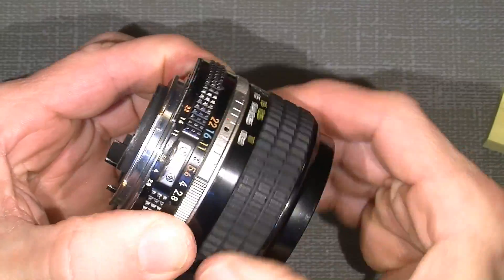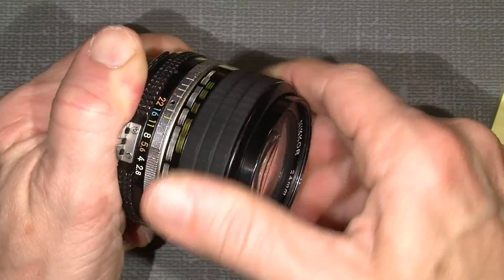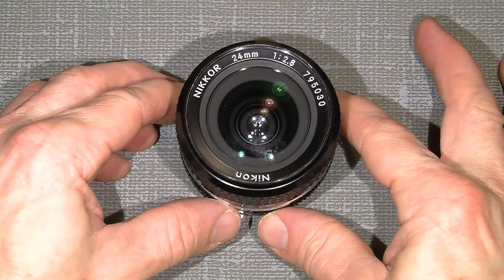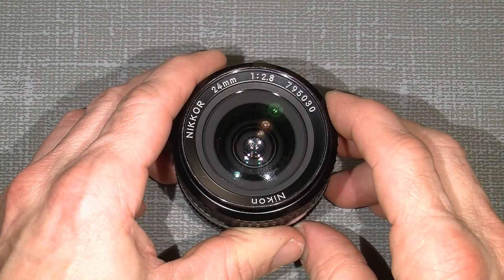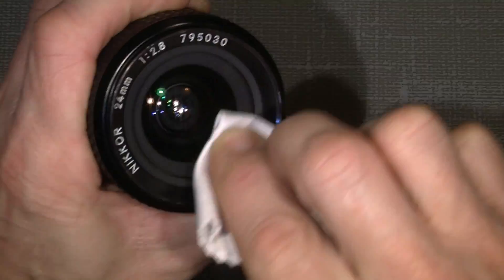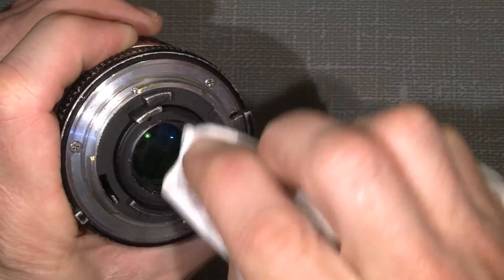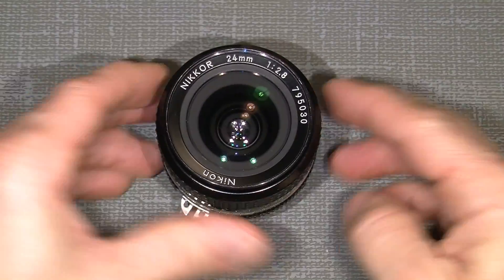So put the focus ring on infinity - because this one also has to be on infinity. And maybe you remember I set a mark where infinity actually is. Then I have my guide pin here that goes into here, so all is going all the way, and hopefully it will catch the pin here. Goes there, and the guide pin is in. Then I just need to add my front ring. Now tighten the small screw here, not too much. Add the retaining ring - click - on it goes and then tighten. Then the rubber band here - put it on so it sits correct. So this old fellow works again. That's it, and I hope you enjoy and can use the information. Thanks for watching, bye bye.